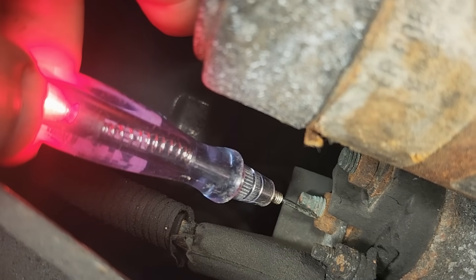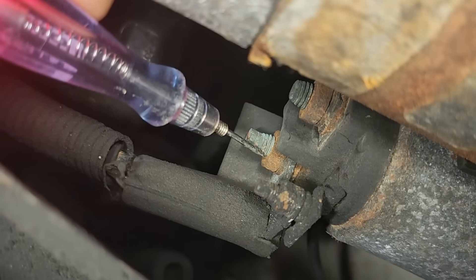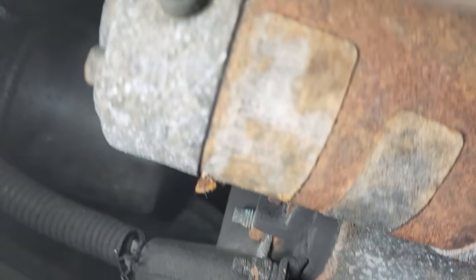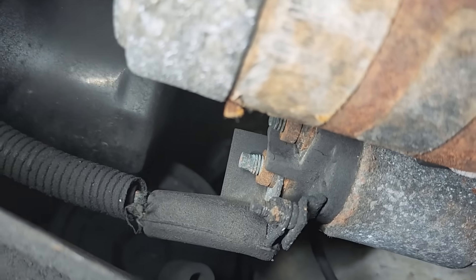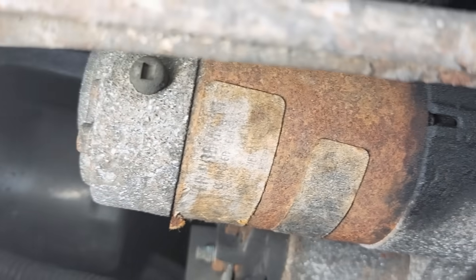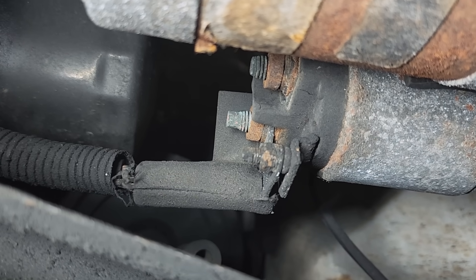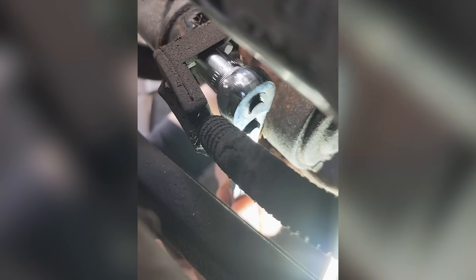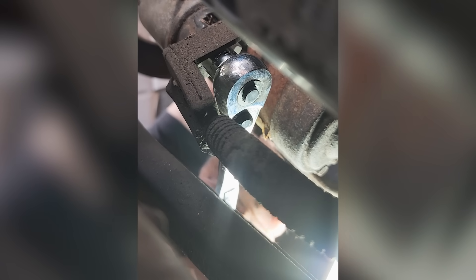Go ahead and crank it. Good. So literally all we need to do is take that nut off, clean it up, and tighten it back up — and this thing's going to start. This is classic voltage drop stuff, Caleb. If we have a wrench that fits that, just snugging that bolt up right now would be enough for us to get this going. What a great case study this is. Starting systems are so simple, and this applies to everything — it doesn't matter if it's a 2020 model year car with stop-and-go starting. It's still the same circuitry, same tests, even though this is a 96 Jeep. I'm not disconnecting the battery, but I'm being careful not to touch anything else. All I'm doing is snugging this just a little bit. That's loose too. And that should be enough.